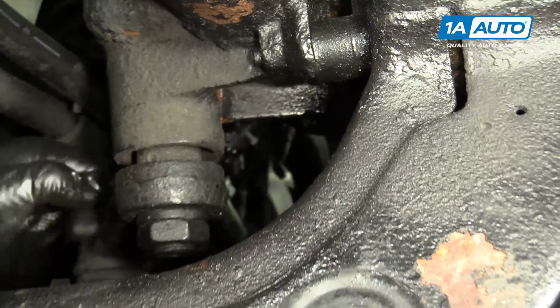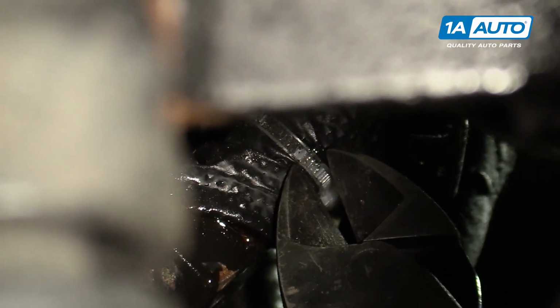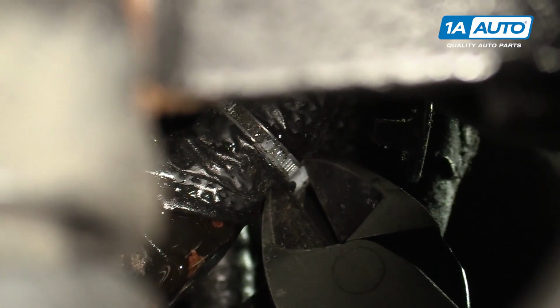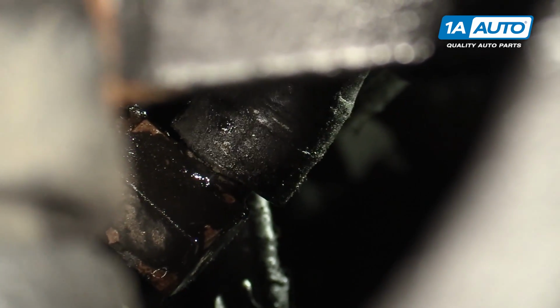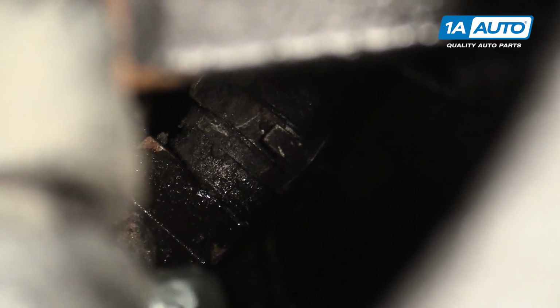And I'm going to cut off the rubber glove finger I put over the return hose nipple on the power steering pump. I should reach up with some side cutters. Might be easier if I spin the zip tie around to the other side. Okay, pull that latex piece off. Reach in and put the return line back on. Slide right over. I'll get my other pliers. Install the clamp. There it is. Okay, clamp is in place.